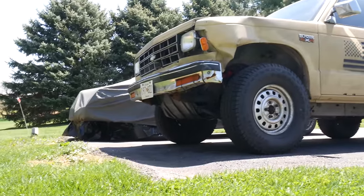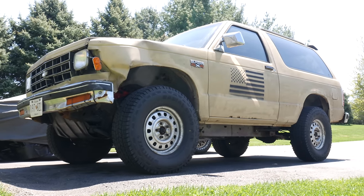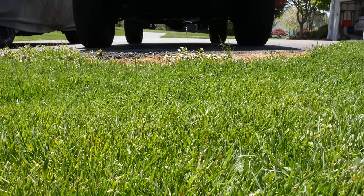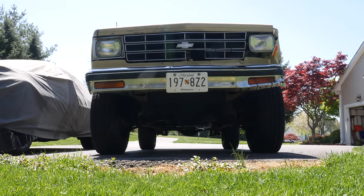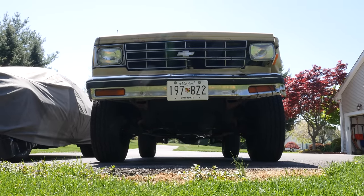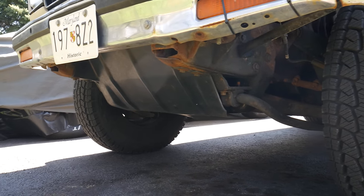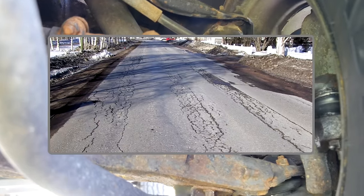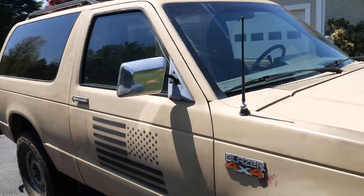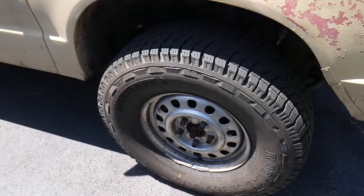This is pretty much my last-ditch effort to try to correct that little bit of steering wander and the bump steer that has only been worsened by installing larger tires. Bump steer basically refers to the tendency of a vehicle's steering system to veer to one side upon hitting a bump. This can be caused by suspension geometry, loose steering parts, tire configuration, all sorts of things. Putting on the larger and wider tires with the more aggressive tread pattern definitely increased the tendency to bump steer as well as the tendency to tramline. Tramlining is where a vehicle tends to follow the contours and indents and eroded surface instead of going straight down the lane. I had a few hairy moments where I hit really radical bumps while turning, and it definitely tried to get me to go into the ditch or a jersey wall.